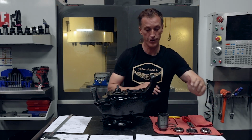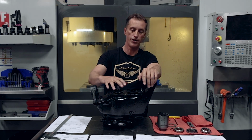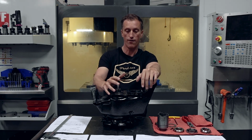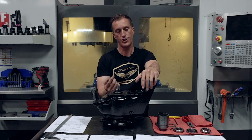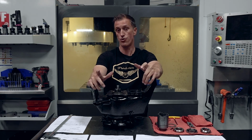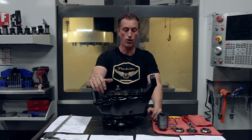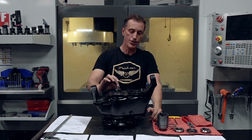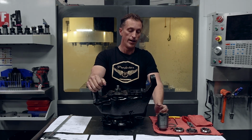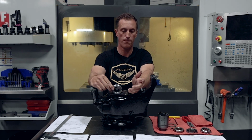Then getting into the Revision B, which is a great way to go, but again, you cannot put it onto a H1 Hummer, because the H1 Hummer, the steering cover that goes across here won't fit unless you do a little bit of work. But the advantage with that one is once it's tight, then it is truly locking in place, but you can also use a standard wrench on it or socket on there. So great way to go there. Again, it's only pinching off on half of the shaft here, of half of the threads, so you're not getting the full lock. Now going to the factory one, which is right here, factory H1 Hummer part.